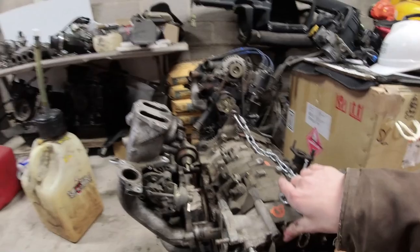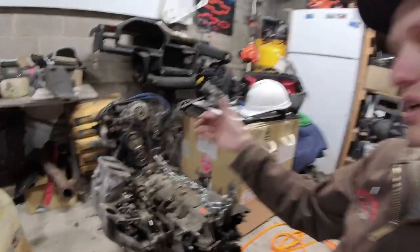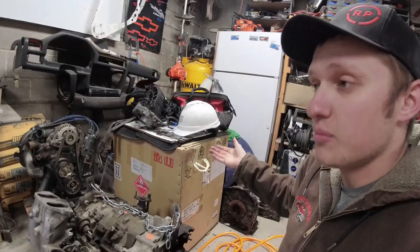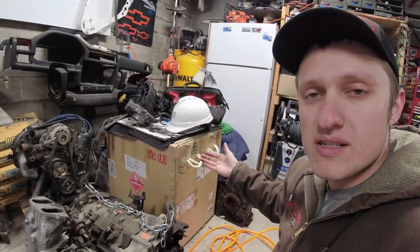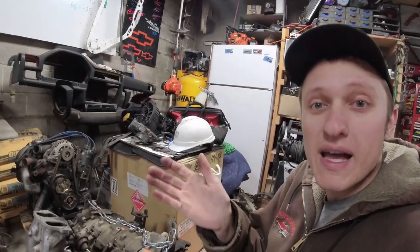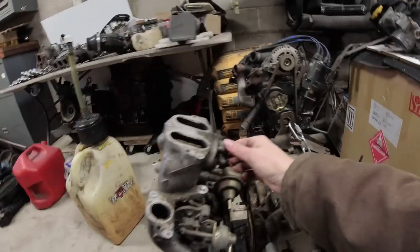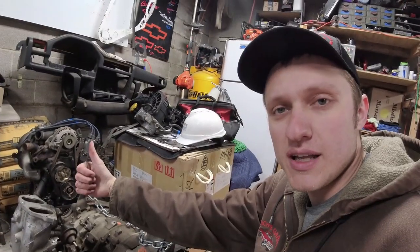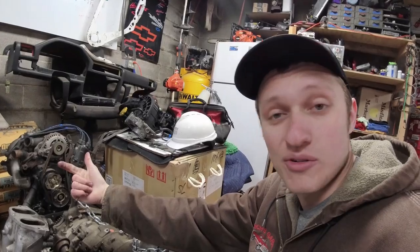So those valves, when the engine and the combustion chambers are not getting hot, will get clogged up with unburnt fuel, because you do get some overlap. You do get some exhaust and fuel and air pushed back into the intake manifold. And when these get clogged up and they quit working, your car will throw a check engine light and it's going to be a dog. It's going to be really slow.